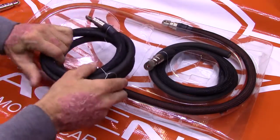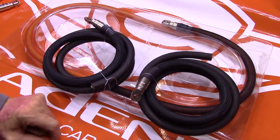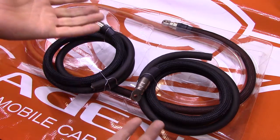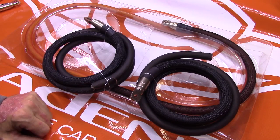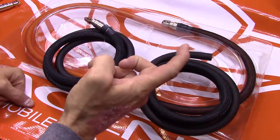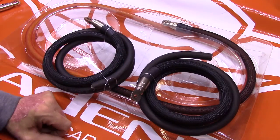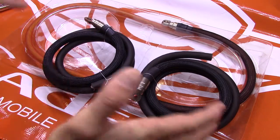One of the primary problems — one of the Achilles heels to an electrical system in a car — is the factory electrical system. The factory electrical system has huge problems; mainly, they were designed for what is in the car only. They were not designed for us to put a 1,000-watt or 2,000-watt stereo system inside our cars. On your battery, there is a small 8-gauge cable that goes from the body of the car to the battery. That's for all the internal electrical systems inside the car — your computers, headlights, whatever electrical component you have. Your car's body is the ground source.